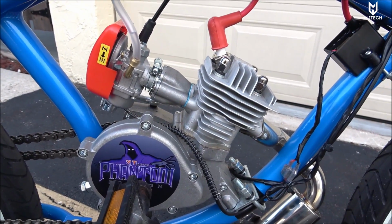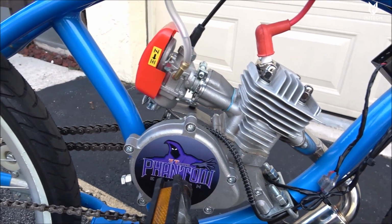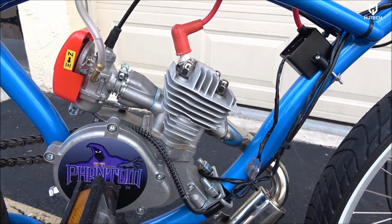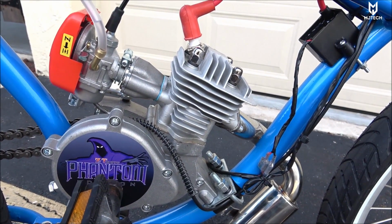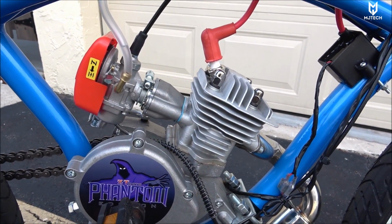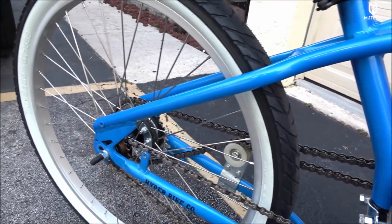And this is an imitation of those Frankenstein motors, as we call them out there. I know a couple of builders who started experimenting with these motors, and I guess it got into the hands of the Chinese, in which they replicated the MS460 cylinder on here. So now again we have a 52mm piston inside. Typically with the China dolls we used to get 48mm.